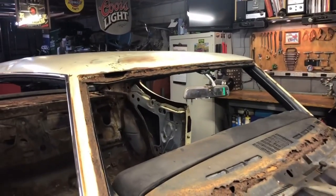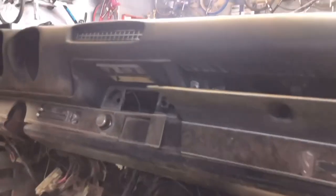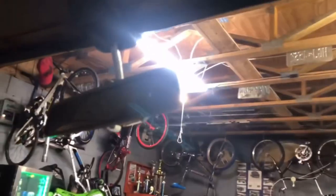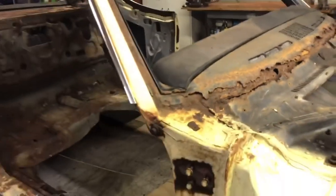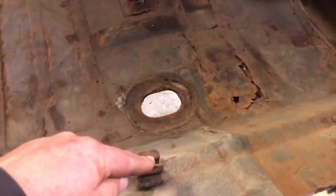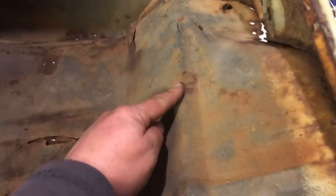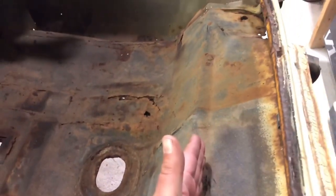There's another set of wiring and studs over on that side. The rear view mirror is still there because the screws are rotted. Now, if this car or any car had N66 — let me show you something: wood grain dash, map lights underneath the dash and under the rear view mirror. One way to tell if your car had factory rally wheels — if you had N66 Super Stock IIs or P05 Super Stock Is — the lug wrench was mounted up in this part of the trunk. There would have been another bracket right here. If you had one of those rally wheel options, that's where the lug wrench went; otherwise it got stowed with the jack.